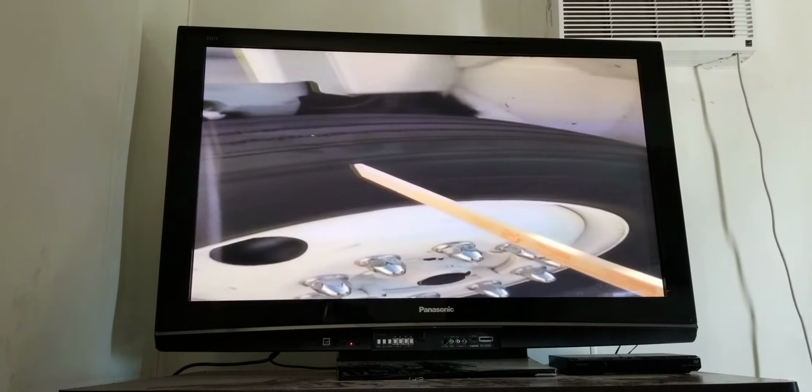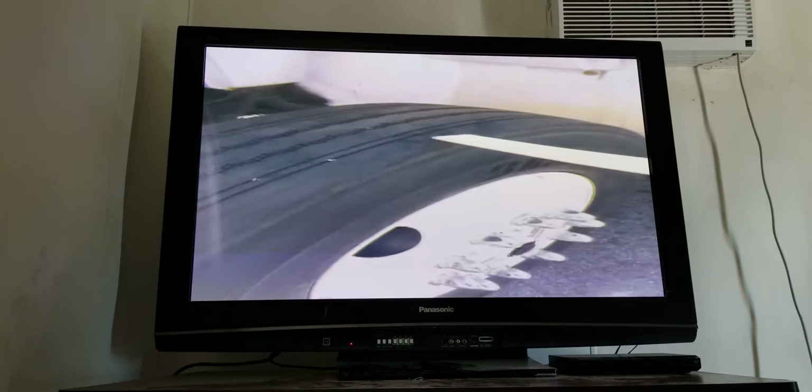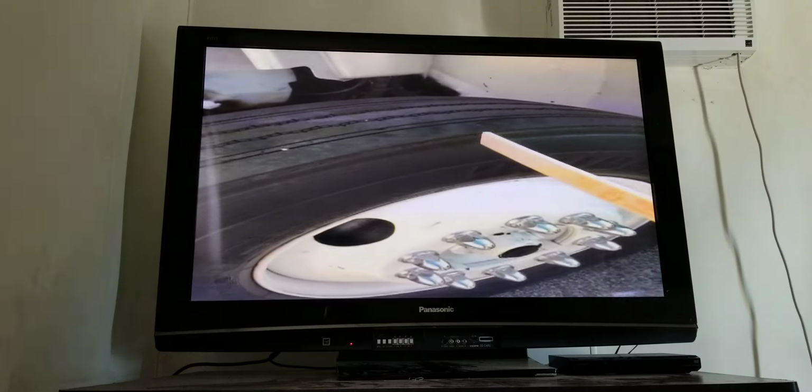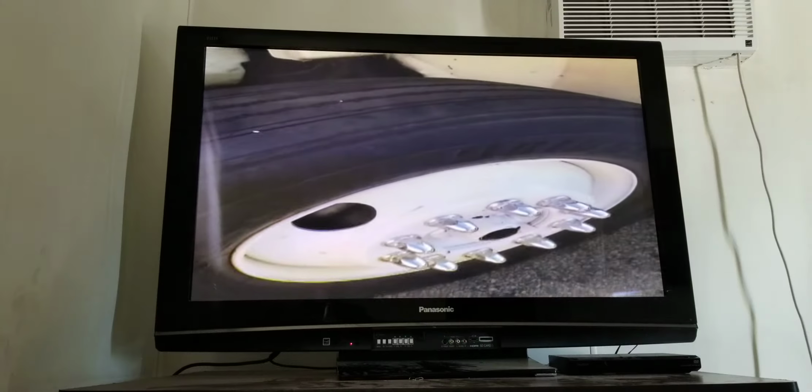I have my steering tire. It is properly mounted. It is a minimum of 4/32 tread depth. It's checked with an air pressure gauge at 95 psi. There's no cracks, cuts, nails, or any damage to the side of the tire wall.